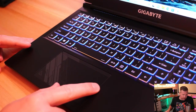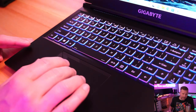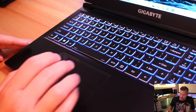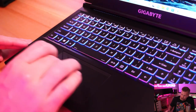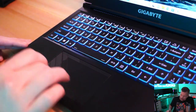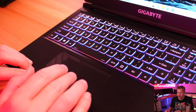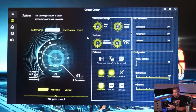Inside the control center software, you can activate and deactivate the camera with Fn + F10. There are four different power modes: performance, entertainment, power savings, and quiet mode. Power savings mode tries to permanently turn off the NVIDIA GPU while in that mode. This laptop does not appear to have Advanced Optimus — it looks like regular Optimus — which means we'll get better performance with an external display.